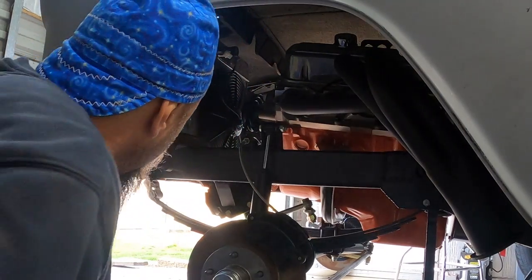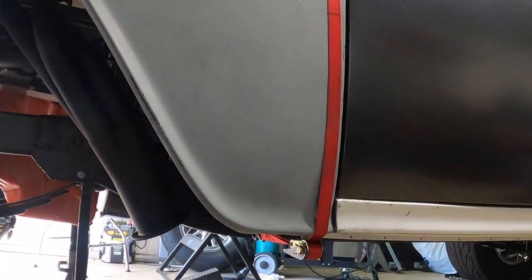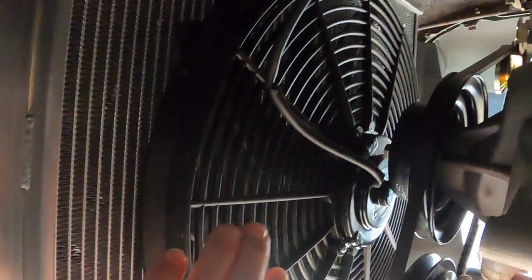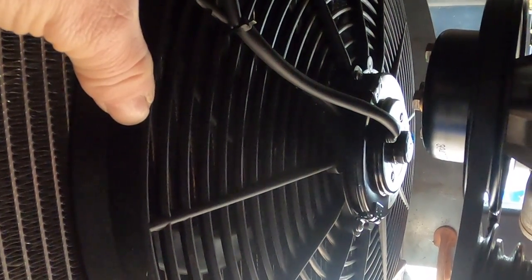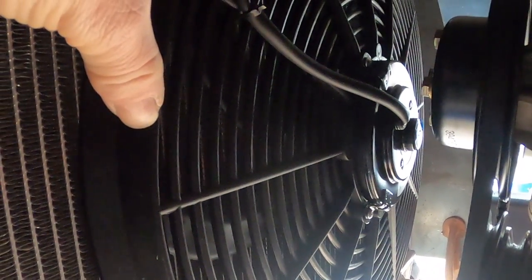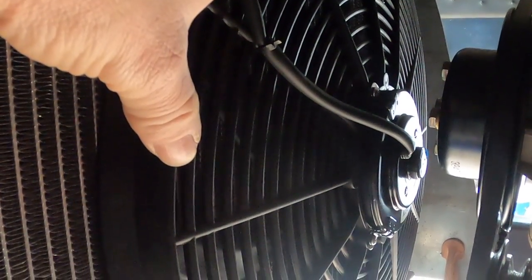Let me show you guys what we got going on here. I came out and set the radiator up in place — we got a couple of issues to work out, no big deal, nothing to do with the bracketing. Our primary fan is electric and it has to be on the engine side. We got the clearance, but to do that we had to slide the radiator and brackets forward a little bit. So we're going to have to nip the corners off of the aluminum bracket and the steel bracket — come down an inch and in an inch — it'll look nicer too, we'll round that off.